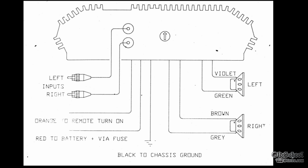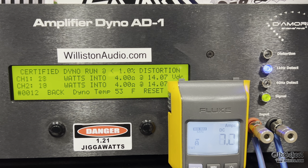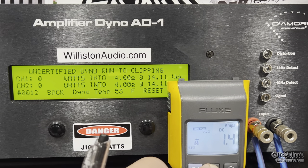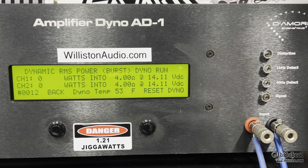First up, we're going to hook the amp up stereo, hooking up both channels to the amp dyno. It is rated 30 watts by 2, and we're testing at 1 kilohertz. Here is the test first certified — can we get the 30 by 2? Yes, we get 39 by 2 right at 14 volts. Let's try it uncertified up to the clipping point to see if we can beat 39 watts — and yes, we do: 42 watts per channel. The channel equality here is really good on this 25-year-old amplifier. Dynamic testing, which sends a 1 kilohertz pulse tone into the amp, shows very close to 44 watts per channel right at 14 volts. Not bad.